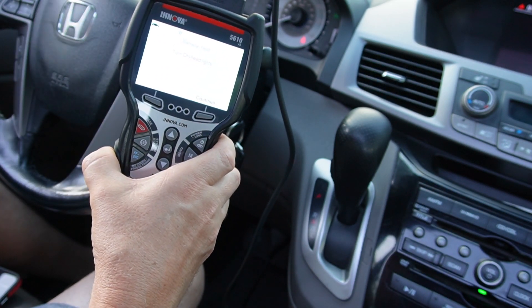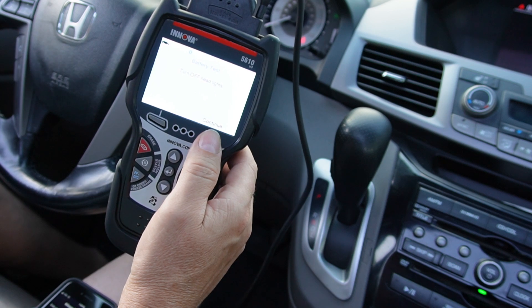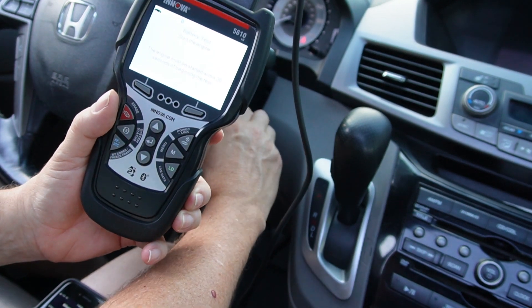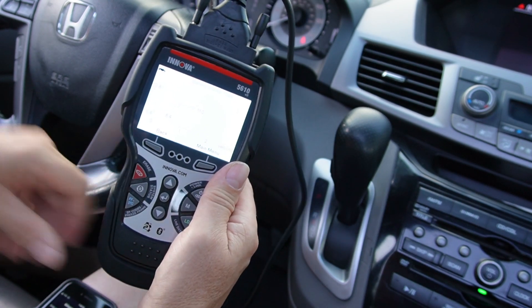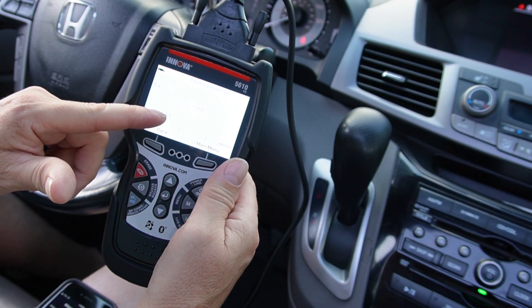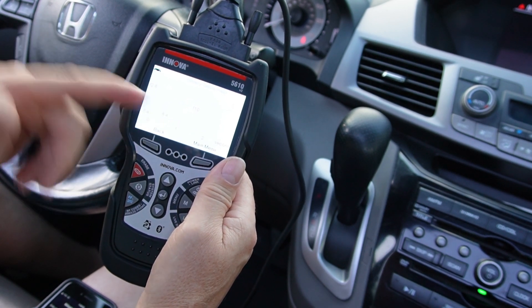Okay, turning on the headlights. Turn off headlights. Continue. Now start the engine. It says battery status passed — even though it shows it went down to 8.4 volts, that was without the car running with the headlights on, so apparently that's normal.